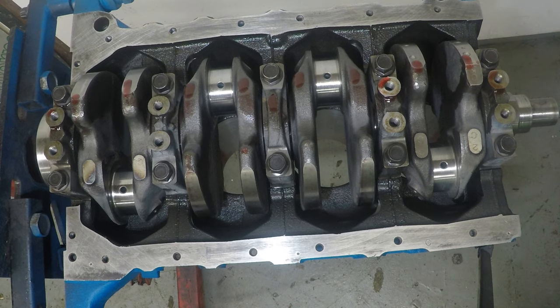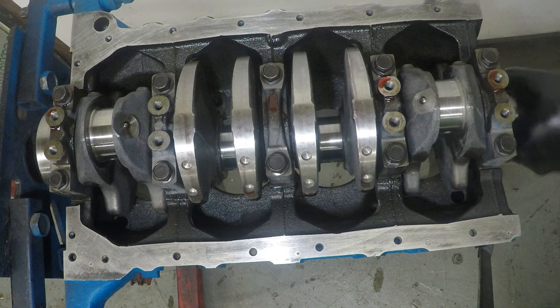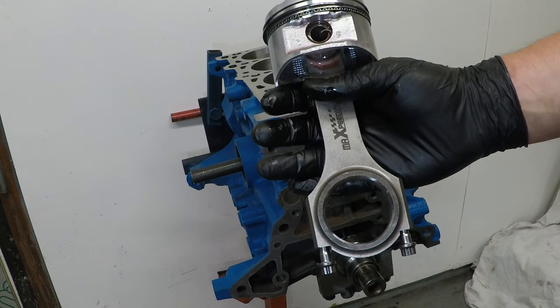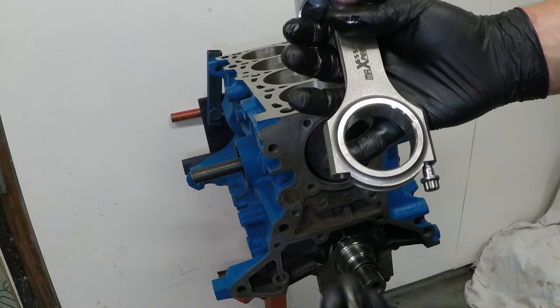Now on the block, I'm going to position the crank so that number one and number four are facing downwards. Remember, this is upside down at the minute. And then flip the engine back over. So I'm going to start off with piston and rod number one. I'm going to take the cap off of the rod,